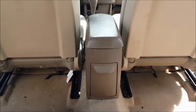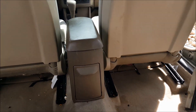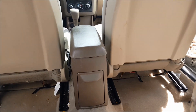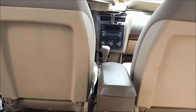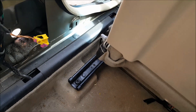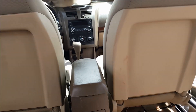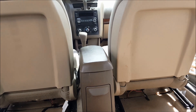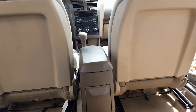Gonna be a real quick video on how to remove front seats in a Malibu 2007. It applies to other vehicles too. There are two torx screws in the back on each seat — I loosened them already. The size of mine were T45s.